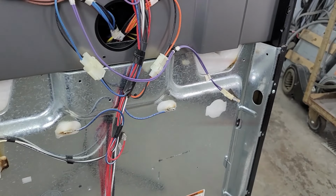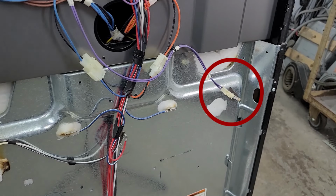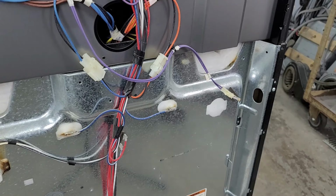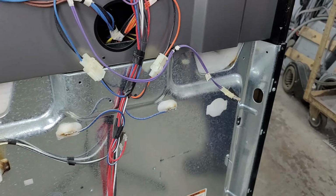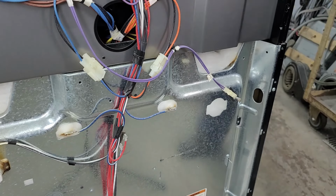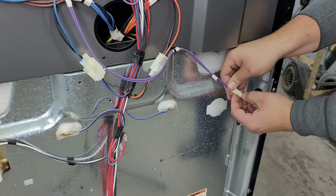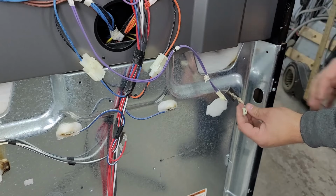The stove thermostat tells the control system how hot or cold the stove is. It's possible that the thermostat is making the control believe the oven is extremely hot, therefore will not heat up. Generally, I find the opposite to happen, that it never is warm enough, causing it to heat up too much and burn food, but we can test which it is pretty easily to find out if this is the culprit